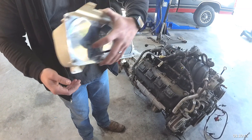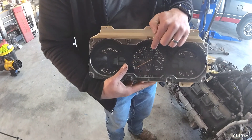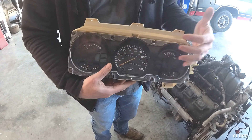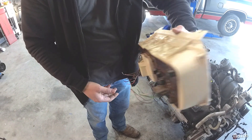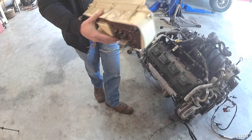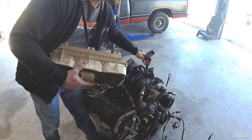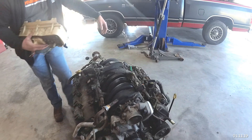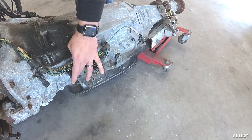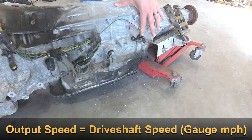Run old-school sending units and you'll have fully functioning gauges. For the electronic speedometer, find the VSS or vehicle speed signal wire and tap directly into the correct port — either on the body harness plug on the Jeep engine, or tap directly into the speed sensors on the transmission. You have rear and front sensors — input speed and output speed. You want output speed, so tap into that signal wire to get your pulse generation and drive your speedometer.